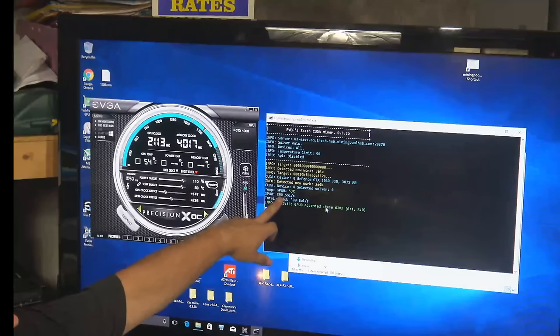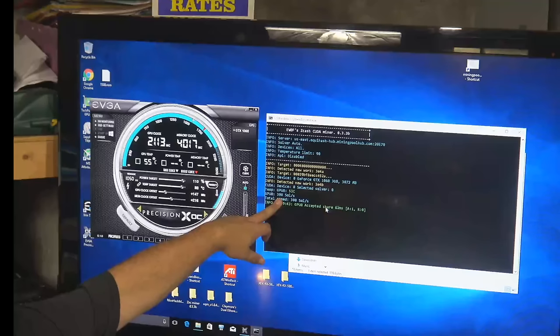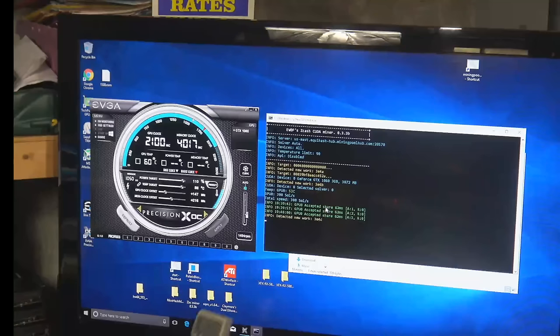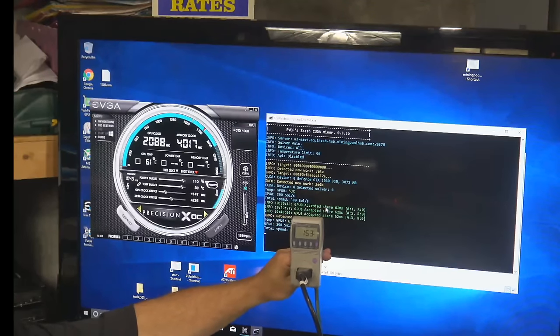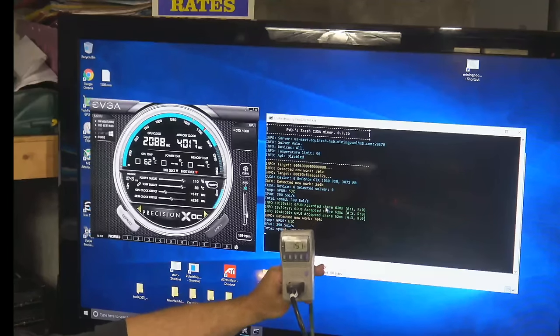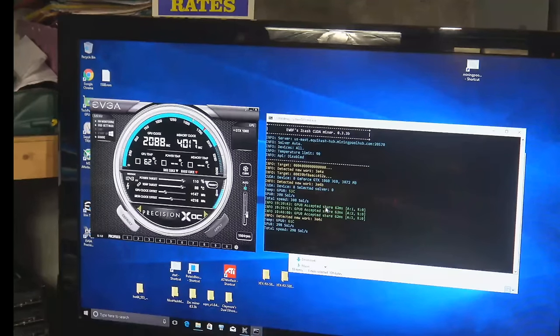Right there, 300 sols, not bad. I mean, you're talking the 1080, which is 529 in cost, you can get in around 500 sols. The 1070 is a little over 410 to 440 sols. So 300 is pretty decent. And now you're talking about 120 watts of power on that. And we're overclocking the power, so it took it up to 151. So it's about 120 on the actual card right now with the TDP.